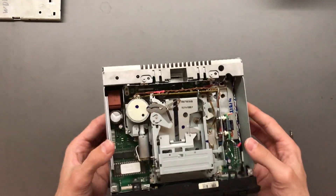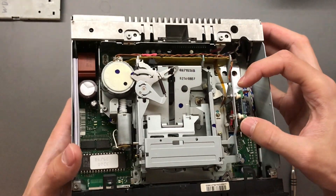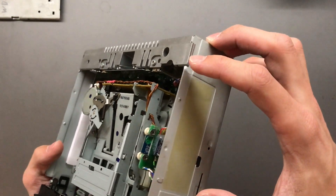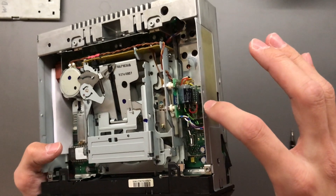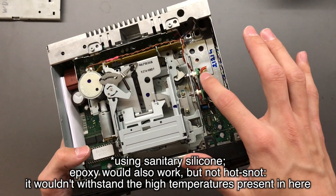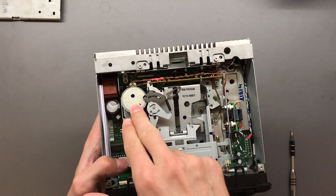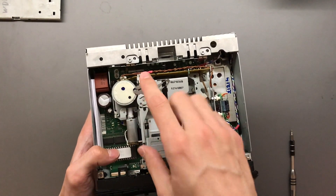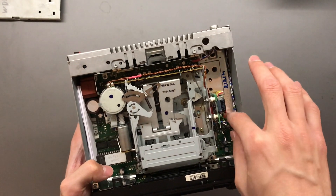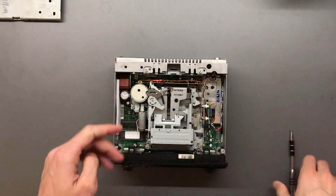Before I remove the cassette assembly, basically this is what we have going on. I've drilled two holes into this metal — was a pain in the ass, that took quite a while. I basically glued the entire Bluetooth slash step-down converter slash capacitor over here. It takes the power from the motor that spins the tape — this will always spin in the same direction no matter how the tape spins, so that's fine. The audio just goes off to these very nice test points on the board where you can just inject the audio.